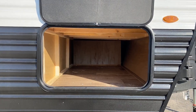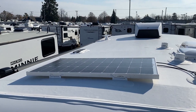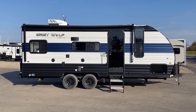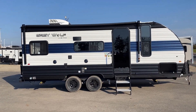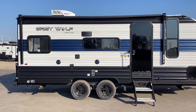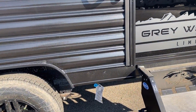The RV does not have a full true pass-through compartment — it's got a big front compartment, and all the water heater stuff is on the other side. You may have noticed the improved 30-amp charge controller instead of the old 10-amp, and an improved factory solar package this year — 100 watts now instead of 50. That 30-amp charge controller means you could expand on that as desired. They were flirting with the idea of mirrored windows and did test a couple build versions, but went back to plain clear non-tinted windows after feedback about fingerprints. That will supersede any Gray Wolf stuff that came out before this.